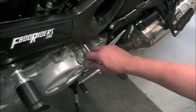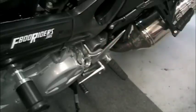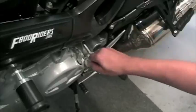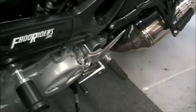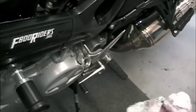Finally, check the engine oil by removing the dipstick and making sure that the oil level is between the indicated markers. Once that is complete, replace the dipstick, and your job in regards to changing the engine oil of an F800 is now complete.